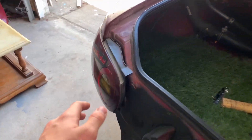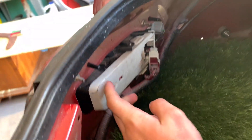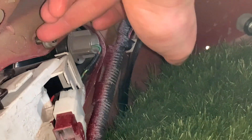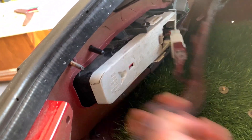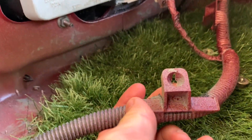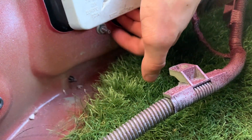I got the Miata into the garage. Taking out the stock taillights is super easy. You have a little connector you've got to pull out, and then you also have four little bolts — one stud, two stud, three stud, and four stud. On these studs, all you have to do is unscrew this little bolt. It shouldn't be held on too tight — I just have mine held on with finger tightness. Then you slide it off the little stud. If you can't find the last two studs, pull on this wire and look down there — that's where the last two studs are. This wiring harness has little clips that slide over the studs, so if you can't ever find your studs, look around under wires.